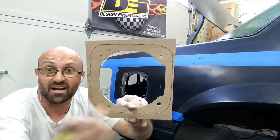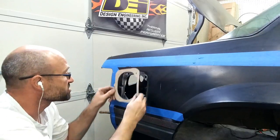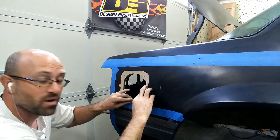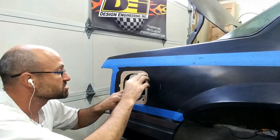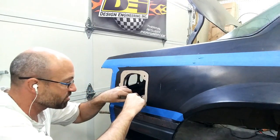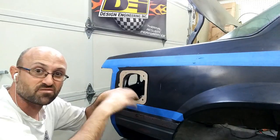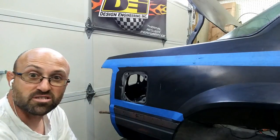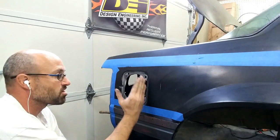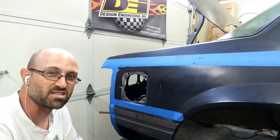So there's the finished product - you can see the line on the outside and now I'm just going to cut it with some scissors. With the ring cut out I can try to fit it and see how it fits. Not bad, but I wanted it to sit at the bottom of these edges - I need to do a little bit more trimming so it sits flat in the bottom of this groove. That way when I transfer it over to the flare it will also sit flat in there and I can easily trace it. I'm going to cut one edge at a time, get it to fit on the bottom, then do the sides and then the top rather than going all at once.